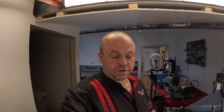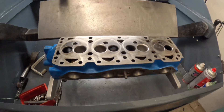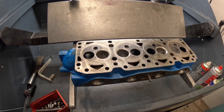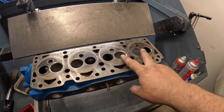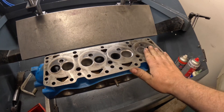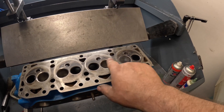Like it's got really wide valve seats on it and a few other bits and bobs. So this is what we're doing for him - we've done the inlets, we've thinned the seats out. And he's right actually - these two in particular are a right mess. These are distorted - they were all different heights - and these two seats were distorted, so I've got them where they're all the same height. And then what I've noticed is the porting is different around each throat.